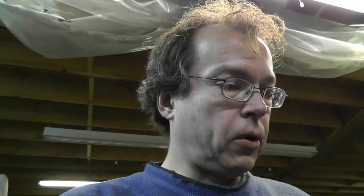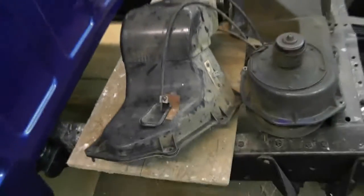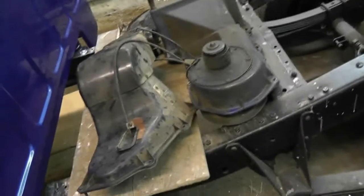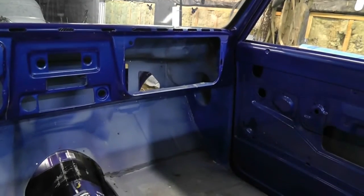I pulled all the stuff out of that truck and brought it into the proper shop here — a little bit better light in here. Heater box is in the engine compartment. I'll see if I can grab one of the other heater cores; I might even look and see if those other heater boxes are better. There's also the interior portion of the heater assembly. I grabbed the wiper arms and the vent units, although the rubber needs to be redone on those vent things — not sure if it's easier to just buy new ones. I pulled the defrost vents, bagged all my parts correctly, and pulled the glove box door and all the associated hardware.